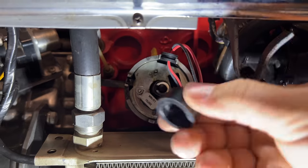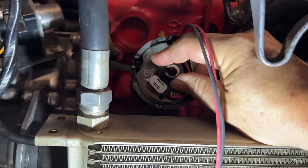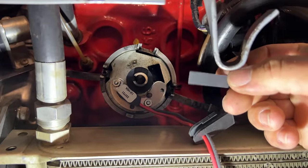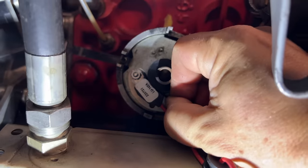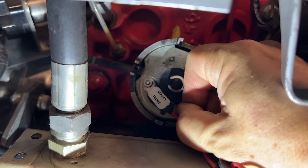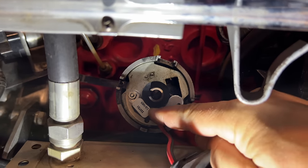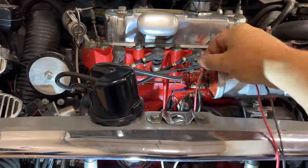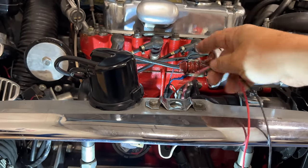Make sure that we have enough slack in here so the wires are not going to be rubbing on anything. Now we can slide the collar on — this collar is keyed. If you've ever wondered what the little piece that comes with the Pertronix is, it's a little feeler gauge. You stick that through to make sure there is enough clearance. Depending on your distributor, sometimes these are slightly adjustable, letting you get the correct distance between the two parts. The only thing left is to cut these wires to the proper length to reach the coil. Red goes to the positive side of the coil, black goes to the negative side.